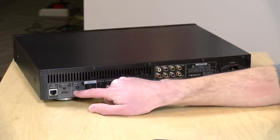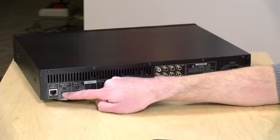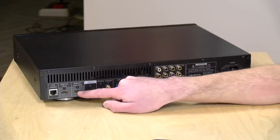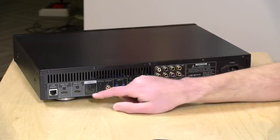It's got two HDMI ports on board, which is really useful if you have an older home theater receiver. If you've got a 1080p receiver, there's a good chance it doesn't work with 4K — not only because it doesn't support that resolution, but also because older receivers don't support the 4K copy protection, HDCP 2.2. So what you can do is run the main output to your television that supports HDCP 2.2, and then run the audio-only output to your receiver. The receiver gets the audio, the TV gets the video, and you don't have to upgrade your receiver. That will save you some money — I wish I had bought this player before I upgraded my receiver.